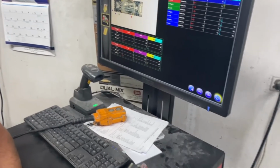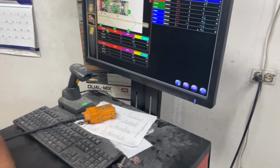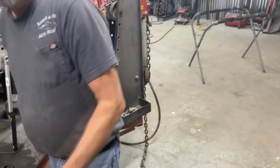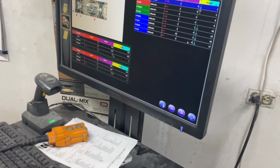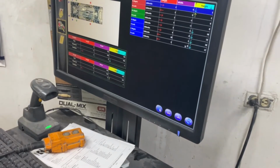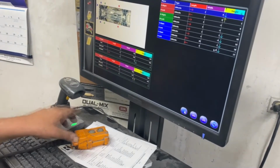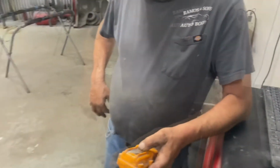All right, let's see where we're at now. Again, the numbers I'm looking for are here. The tool's in the way, I can't read. Okay, now I'm 1 millimeter wide on the end of that rail, and I'm 8 millimeters in on the left rail. It's just what I thought when I unbolted. I pulled everything as far as I could. Sometimes you pull the car off the stand and you have to go individually on the rails. That's also changing my heights, which I like. So we're going to make another tug here on this left side.